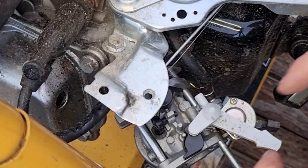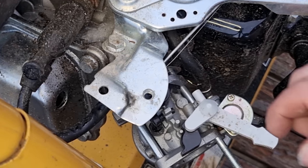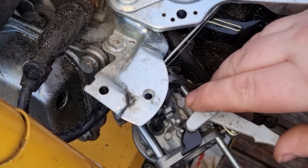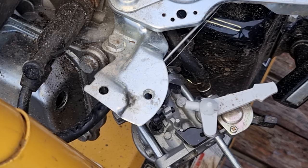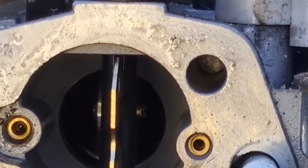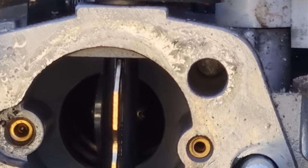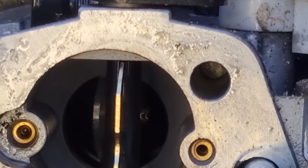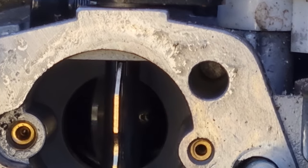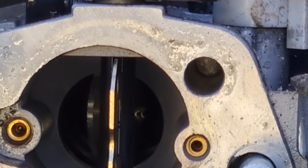So the way the governor works is: as you put load on it, the spring causes this to open and close, and that in turn gives more air to the engine through the carburetor. I'll show you what that looks like now. This is the internal view of the carburetor with it fully open. As you can see, when I move that governor arm it opens and closes a valve on the inside, letting more or less air in. Obviously it's not moving as much as I'm doing it manually, but it will just go backwards and forwards as the engine is put under pressure.